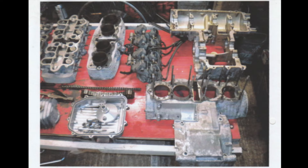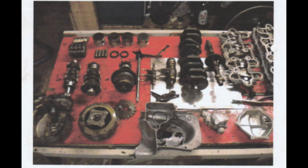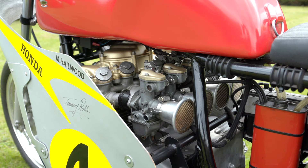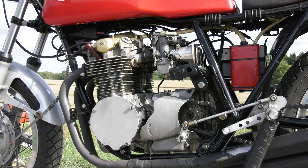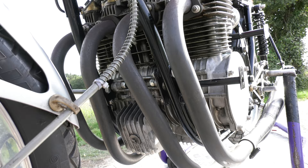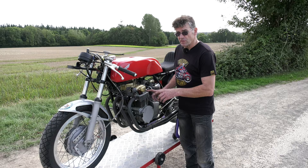So what have we done to the engine? Completely stripped on the bench, everything's out of the engine. You've got the crank out, the rods out — and the rods were corroded, they were rusty. So they went into a cabinet and were blasted. There's nothing wrong in the bearings so it was kept standard. The bores were okay but the bike had been standing, had locked up on a few of the pistons, so that was all honed out standard. It's all standard in there — it's a really good engine.